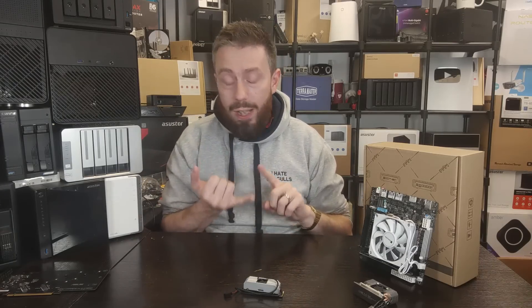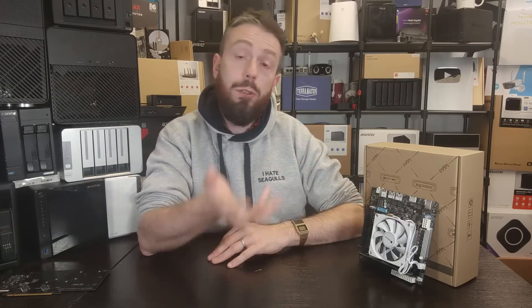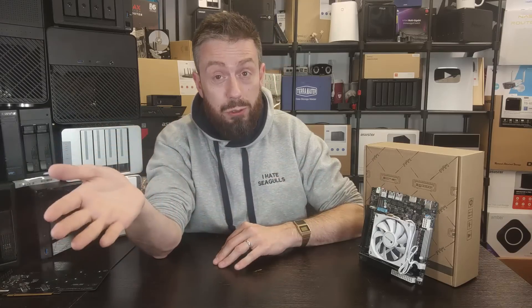I will also argue the idea that it now supports Intel vPro network management, which is going to be tremendously useful in a NAS capacity. When you're utilizing this motherboard in your NAS setup, you're not going to be dependent on accessing just the BIOS via a KVM - keyboard, video, mouse interface. Thanks to Intel vPro EMA service, you can allow for network remote management via the BIOS and the Intel EMA user interface, which is hugely important. We're seeing more and more business-class NASes arrive with that out-of-band access to the system.